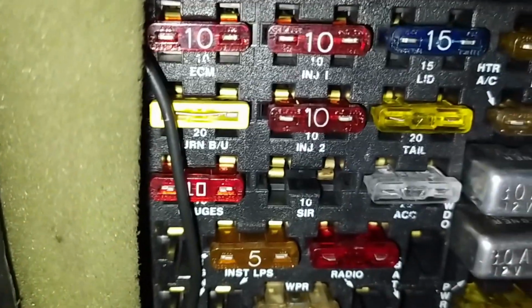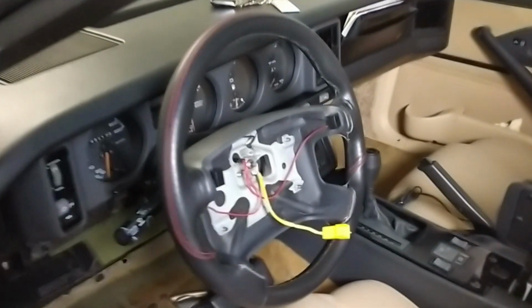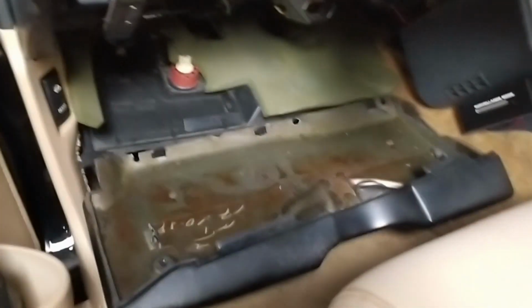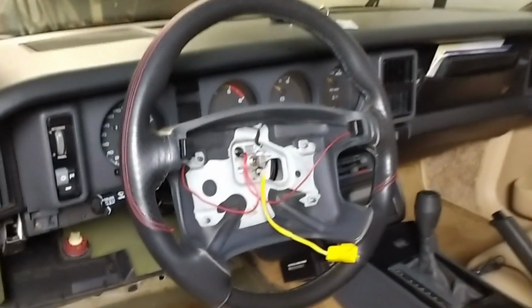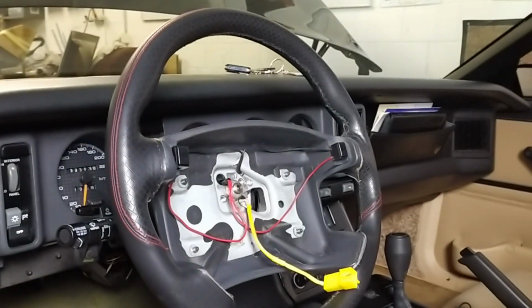This one here, I'm just going to pull that one. That's it. I've already started to remove the steering wheel, I've already removed the airbag. Also, since I've already done this in another video, link in the description. A couple of 4 T25 screws to remove the airbag element and then unplug the yellow cable. And then I went ahead and also lowered the underdash cover in case I need to access or pull back that yellow cable. But now all it takes is to take a steering wheel puller and pull out the old steering wheel, and then we can look into mounting the new one.